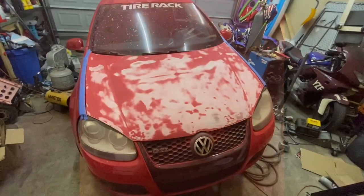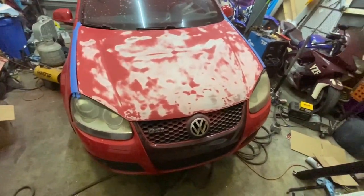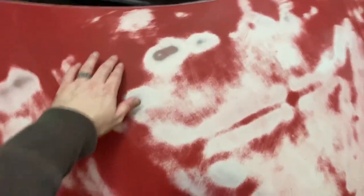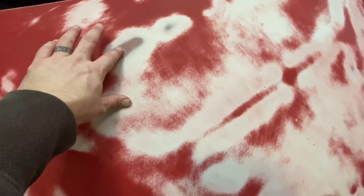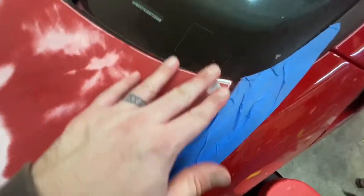We got a little bit of a kick up at the back of the hood so you gotta be careful on that too. Here's what we ended up with on the hood — as you can see there's a lot of white showing, but that's okay. There are a couple spots where I got through the base primer, kind of along these edges, and basically you try to avoid that as much as possible, but if you get a couple it's okay — we're priming this whole thing before we paint it anyway.